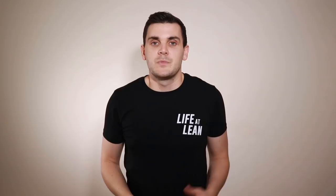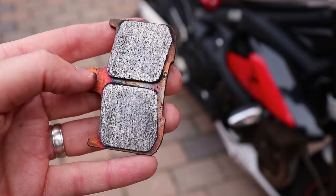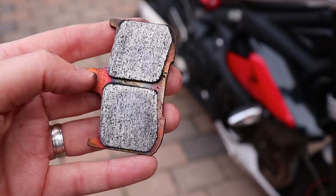Up next: upgrade the brake pads. This is another fairly cheap way to upgrade motorcycle brakes. By upgrading to track-biased pads, you'll not only gain more outright performance, but you'll also be less likely to experience things like brake fade. The most popular form of track brake pad is a race-sintered pad. These contain metal particles that not only improve overall friction characteristics, but they also handle heat better, which is why you're less likely to experience your brakes fading. The standard of stock brake pads are as high as they've ever been, and some manufacturers actually employ sintering already, so it's worth looking into what your bike manufacturer offers if you want to stick with stock pads.